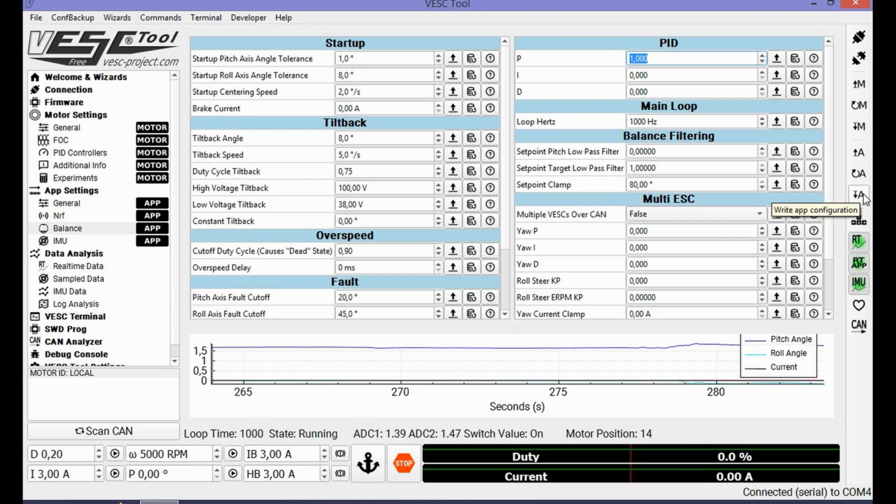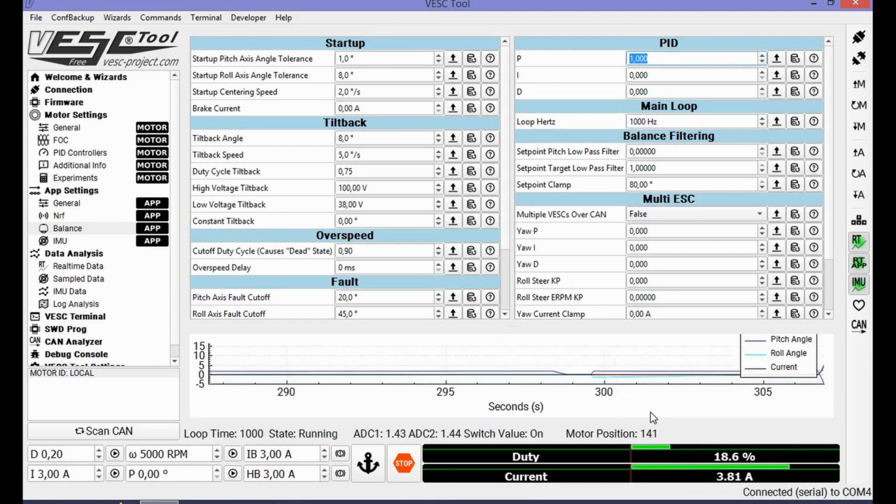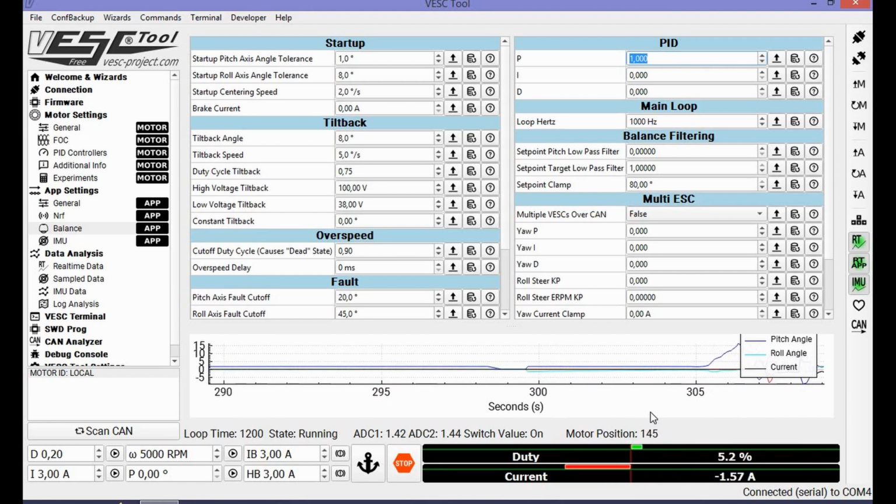the motor will start, and as you see I should calibrate the IMU because the pitch is at 1 something. Then you will see the duty cycle go up and then it will cut off because it will hit 75. I'm gonna save. Still nothing. Oh, there we go.